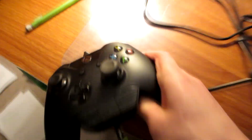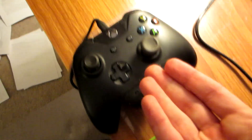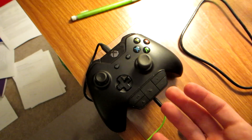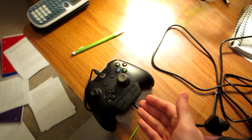Just bear in mind that DVI does not transmit audio, so since we're using a DVI converter, it's not going to transmit audio to the monitor. You'll need to get external speakers, or — an easier solution — just get the adapter for the controller and plug in headphones. This is the best solution: don't go out and buy external speakers, just use the converter and plug in any existing headphones you want. It works great.